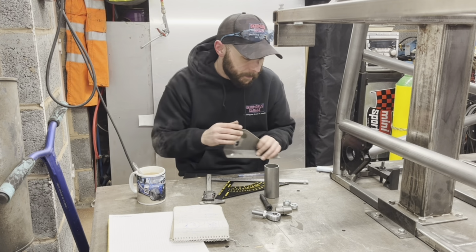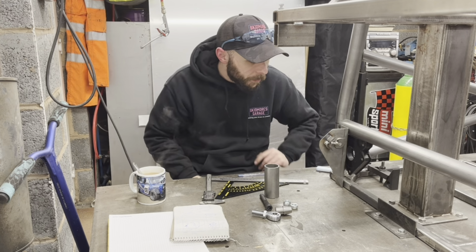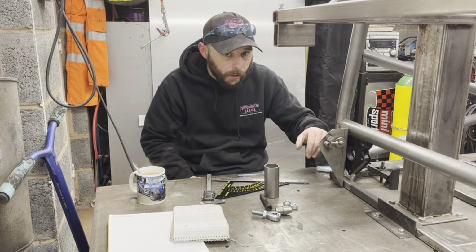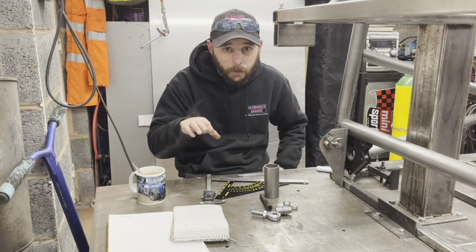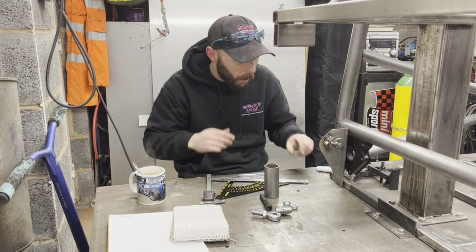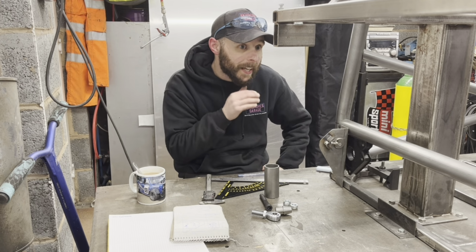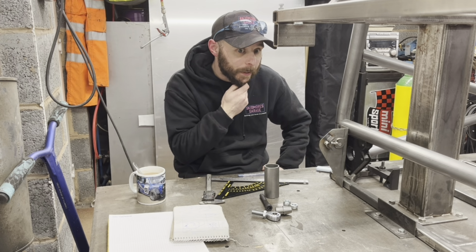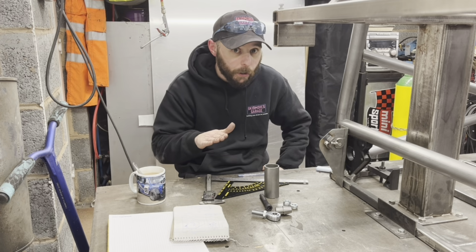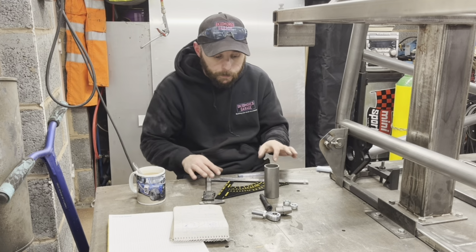So what we've got is one of my radius arm mounts. The only thing I need off that is the height, because that represents the center of the rear spindle on my chassis, which gives me a 3.5 inch ground clearance. Now I have got some wheels coming, some 13 by 8 without tyres, which technically, once on the hub, should be at the right height, because my tyres are about 3.5 inches. But we need to come up with some drawings.